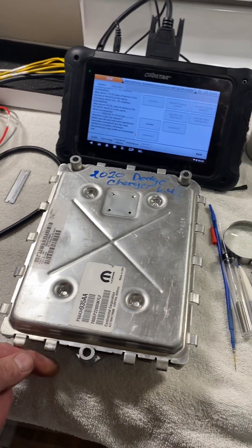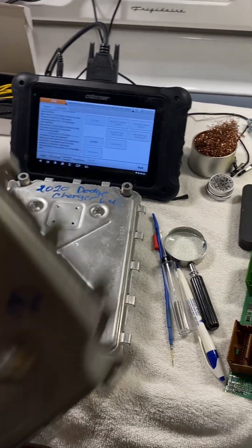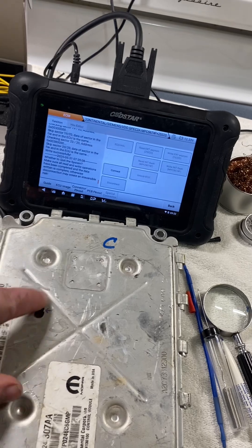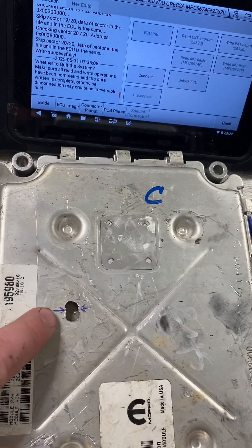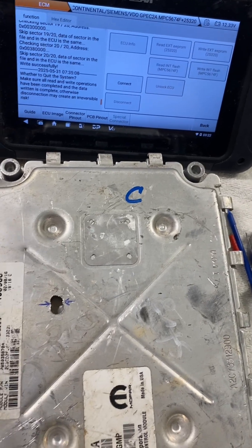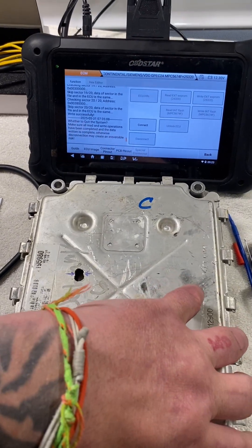To start, you can open it up, flip all those tabs up, pry it apart — or you can take an old plate. These just push down into those holes, you line it up, and you can drill right there with a spot weld tool so that you don't drill all the way through, and then you pop it out with a pick.